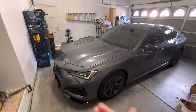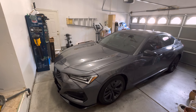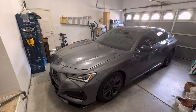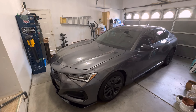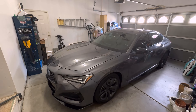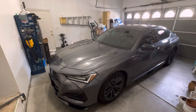It's an easy swap. And if you want to go to the dealer and swap your old one back in, it's a simple switch — nothing involved. Check the link in the description. Right now that adapter is $35, so it's really cheap. It doesn't come with a filter, so you'll just have to get a cone filter — between three and a quarter inch to about three and a half inch will fit. Then you just clamp it down. Whether you get a name brand, off-brand, or a reusable one, it just clamps right to that and you have a quick little intake with some noise, if that's what you're looking for.